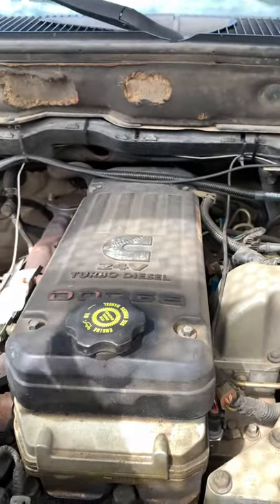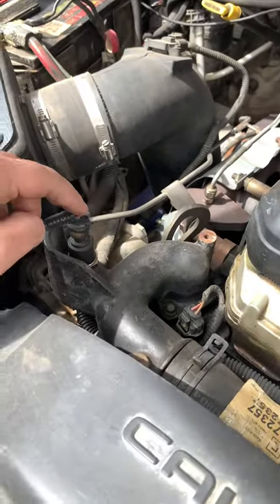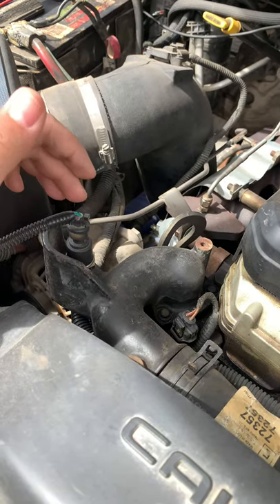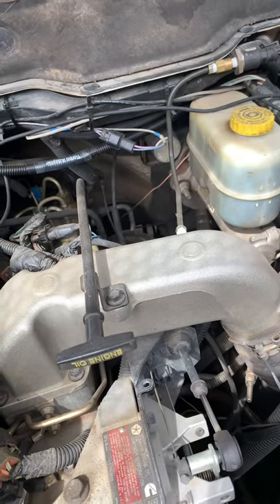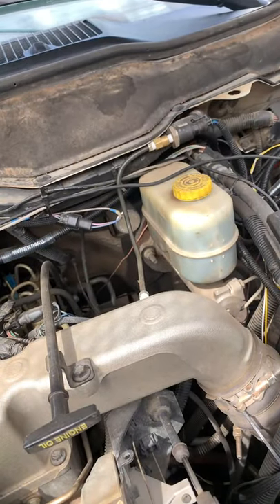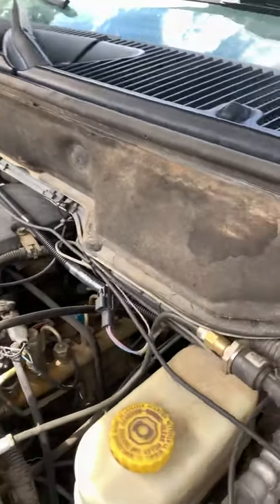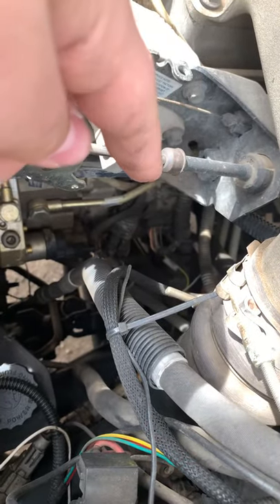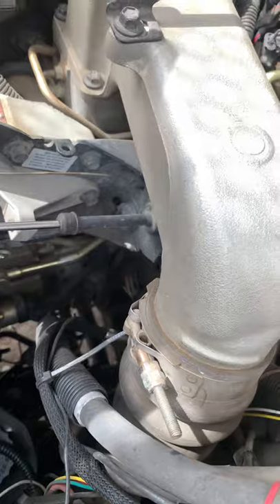You can see Steed's controller back there dangling — that'll get cleaned up eventually. He'll send you two of these little pressure deals: one goes into the thermostat housing like it is here, and one goes into your intake horn. I just have mine hard ground right up there. You plug into the turbo over there, run around, come to his controller box, and then you have to plug in two wires down on that controller for the truck. And that's all you have to do — it's really just plug and play.